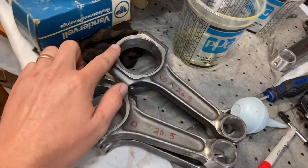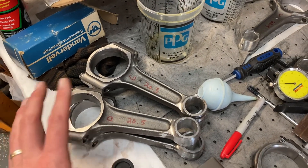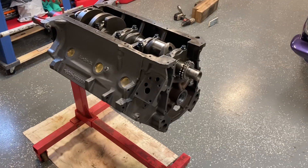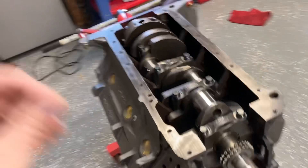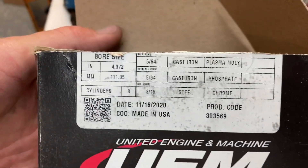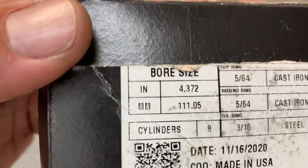There is a reason I'm not checking my rod bores without bearings. Ed did check them all and explained there were a couple that were tight that he had to open up just a little bit, so he assures me they're all in spec. My next steps are going to be to assemble rods, get the rings on the pistons, and get everything ready to put into the block. I want to flip her over and check piston ring clearance in each cylinder. Here are my piston rings that came with the pistons — looks to be some cast iron plasma moly.